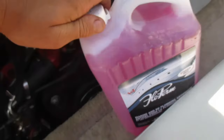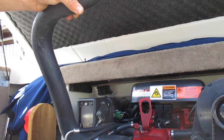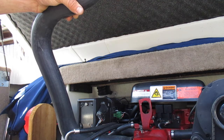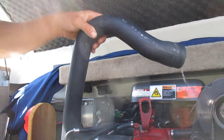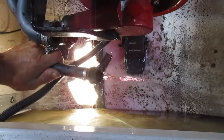Take your bottle of non-tox here. You don't have to do this but it's good reassurance that this motor is not going to freeze. When you see the pink come through, you know it's not going to freeze. Pour it in and wait for it to come out that hose at the bottom — nice and pink coming out of there, so you know you're good to go.